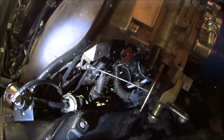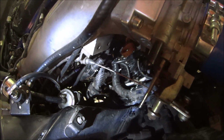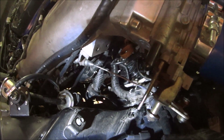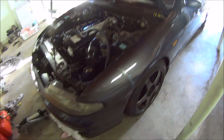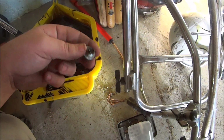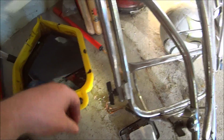Then I'll stick a new oil filter on there, and tomorrow I'll put more oil in the car. In fact, there's probably no reason to wait till tomorrow. Probably run out quick enough to do it this afternoon. Well, I found one very good reason to wait till tomorrow. The sump plug is a standard one, and I really want a magnetic one, so I'll have to go and buy one tomorrow. And I can't put the sump plug in and then put the oil in and then take the sump plug out. So tomorrow morning I'll finish the job.